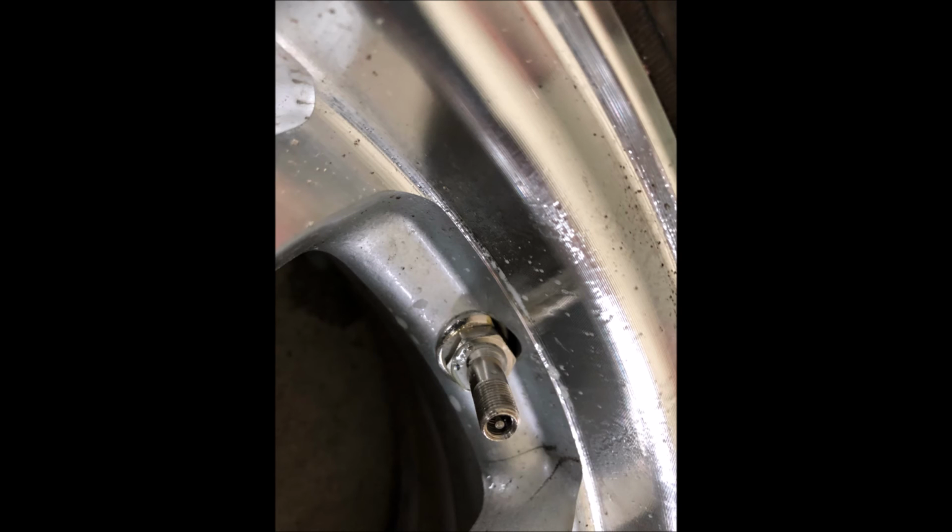This is how the finished product looks without the TPMS sensor on top of the valve. You can see now how that modified washer fits on the rim. Check for leaks with soapy water after refilling the tire and prior to putting it back on your trailer. One other tip I can share with you is to make sure you buy 5 metal stems and also convert your spare tire to the metal stem in case you need it down the road.